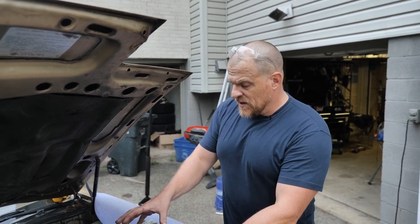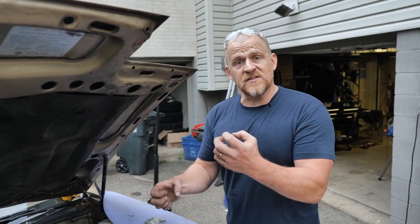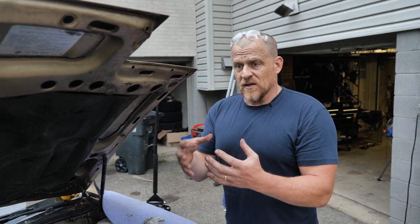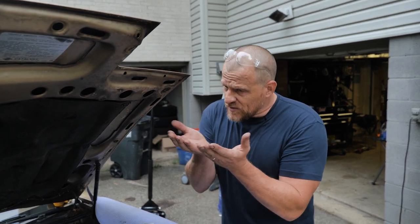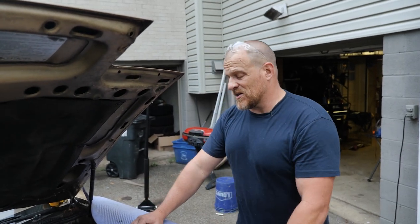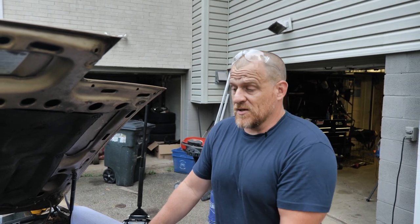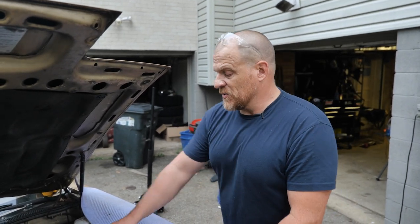It allowed me to make movements in the line when I was finished, where when you're using a press type fitting or a welded fitting, you can't make adjustments. You better make sure that you mark those lines and have them oriented right. With this design, I was able to make those final adjustments on the car, so I really liked that. And for me, I don't do a lot of air conditioning work, so it doesn't make sense for me to tool up and go on Amazon and buy a press. You can get a press for $150, $175 and get the fittings, and you can fix them if you have the right fittings. To me, this setup, that's the way I'll go in the future too, especially with older cars.